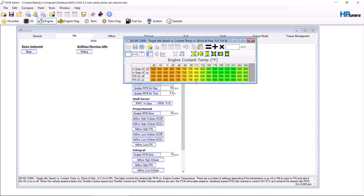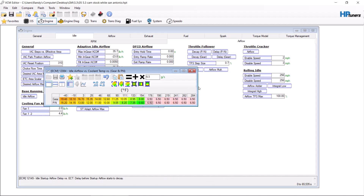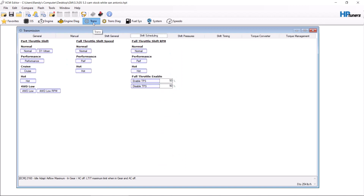Leave that stuff alone. Go back to engine, check idle. We're giving them that cam sound, so let's bump it a little bit. Plus, GM truck idles are kind of low — we'll bump it to 700. We're also giving it the cam sound, so we should give it a little bit more air at idle — let's say 6.5 grams per second. Make sure this is in grams per second. This is so it doesn't die when it's idling from the lope or rumble.